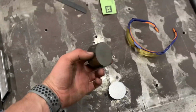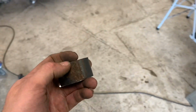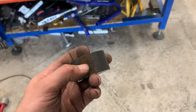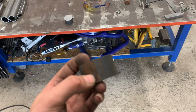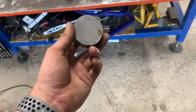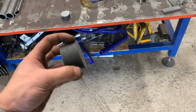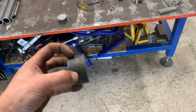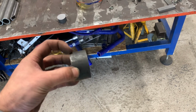Right, all right, then we've got these little nuggets I'm making. I'm doing these 30mm. Don't need 30mm, but I'm doing them 30mm, because I want 10mm on the outside. I'm going to go, might go 15mm sliding inside the tube, yeah? It's going out of focus. So I've got enough here now to grab it, face it, do my 15mm, and I've got enough to hold.